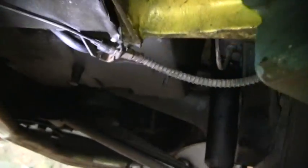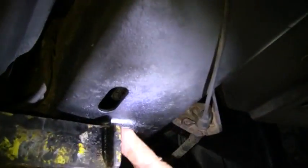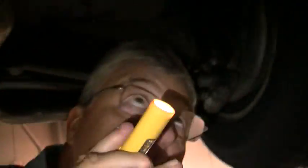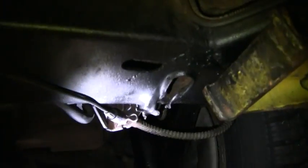There's one little issue here on the cross member. First of all, this is a rip. Let me show you over on this side what it should look like — you see the little hook. This is where wreckers use for a tie down of their chains. Over here, it looks like they put one in there and it pulled too hard and ripped this out. Now, a cross member is very solid and it's to support the rear end. And as you can see, the rear end right here, this is what they call the tongue bushing from the rear end, where when you engage it, it'll push up against here. So this is a part — it's in good sound condition, but as far as cosmetic, that's a little issue.